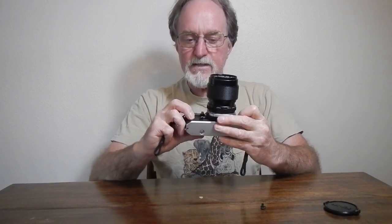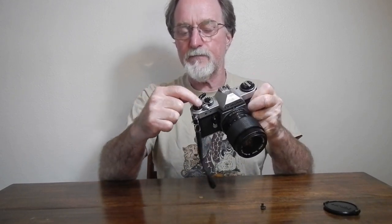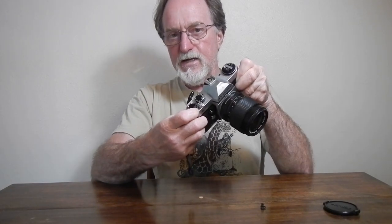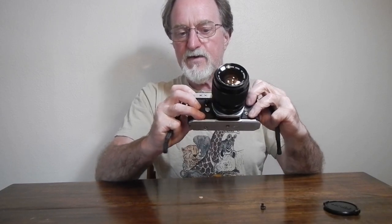This little thing around the shutter is a shutter lock so you're not accidentally taking pictures of the inside of your camera bag — it just defeats the shutter button. There's a self-timer that's good for 5 to 13 seconds. You pull that down and then the little lever underneath it is how you start it. The little indicator is kind of in between the film counter and the shutter button. There's a tiny window, and when you're wound it turns red; after you've taken the shot it's black.